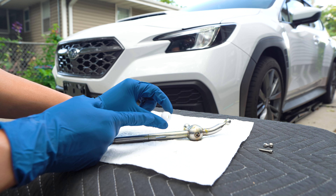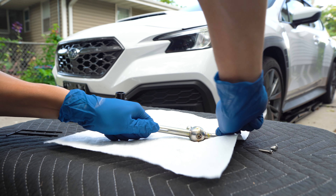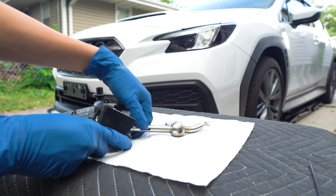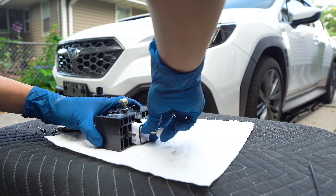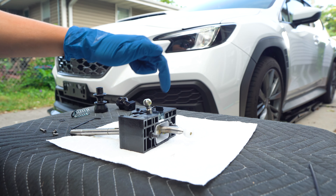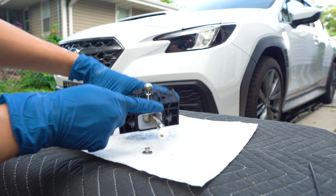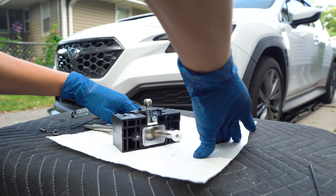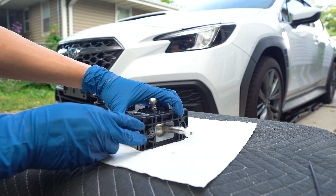For reassembly, you're going to want to pop off the white cap that was on the bottom ball joint of the OEM shifter and transfer it over to the new one. With everything greased, now it's just a matter of putting it all back together. We're going to slide the new shift lever into the sub-assembly and reinstall the white plastic portion, making sure the O-ring stays in place. One thing you want to pay attention to before you put the cover back on is this nut right here — it tends to fall out when you're disassembling things. It slides into this opening here, so make sure it's in there before you put the cover on. Otherwise you're going to have to take it off to put the nut back on. With that back in place, we can reinstall the cover with the two 10-millimeter nuts.